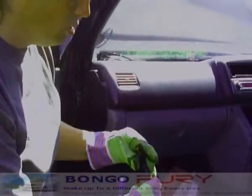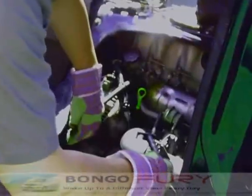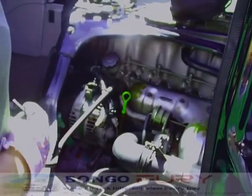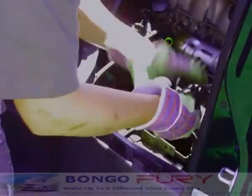Just drop the hose down. As it's dribbling out, you pop the bung in. Try not to get it on your hands because it's very hot. Put it in nice and tight. The clip goes back on and you clip it back in place. That clip goes back on — takes a bit of persuasion. And then that clips back in. Checking again that the hose isn't chafing anywhere.